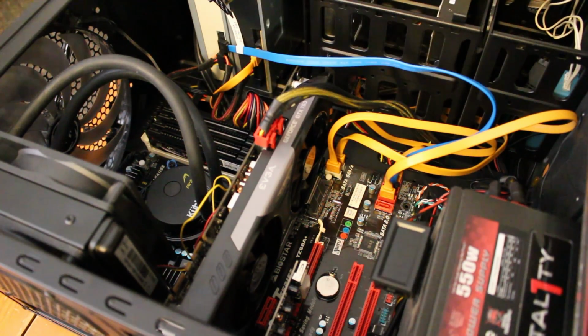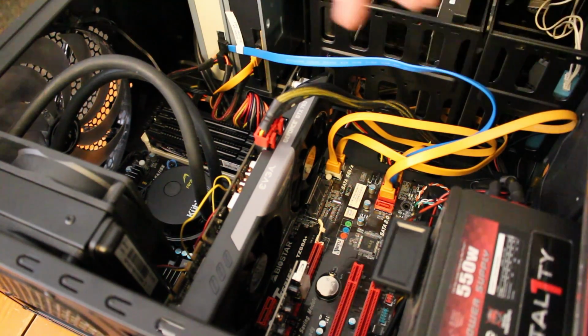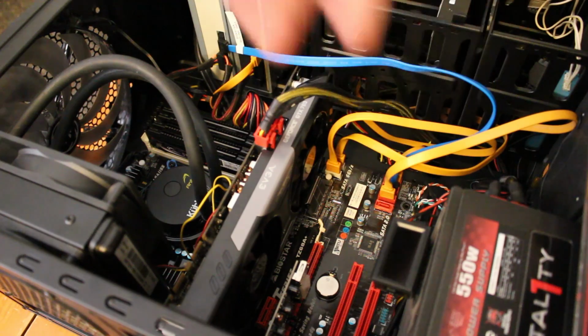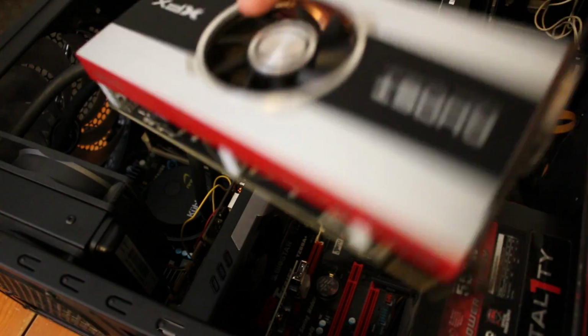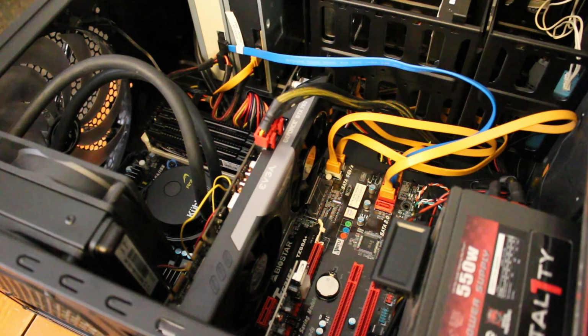The thing is, though, the video card was kind of the bottleneck on that. Uncompressed video takes up a lot of space, but it's not that hard to record. While I was recording in X264, it doesn't take up much space, but the entire time it is actively rendering it. So it's not like it records a video and then renders it. No. The entire time I am playing a game, I am recording footage, and I am compressing that footage down to X264 all at the same time. And the CPU is fine for that, I know that for sure, but this card right here, just not cutting it. So when that happened, I ended up ordering this card here, and I'm about to hook it up. We're gonna see what happens, and I really hope it was worth the money.